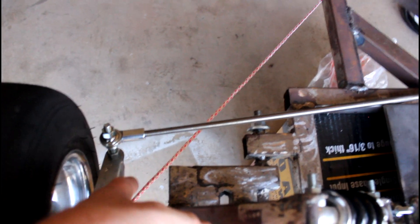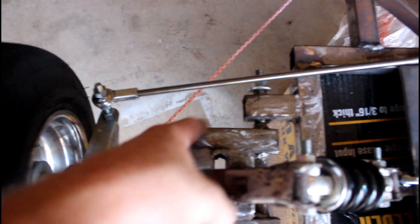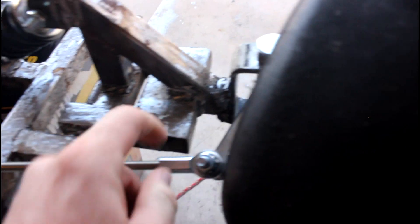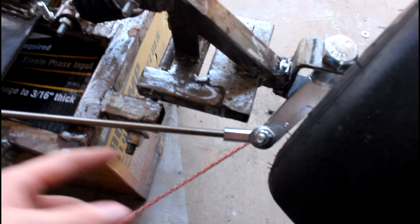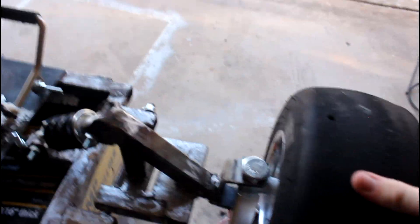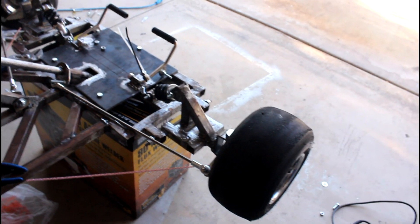What I'm going to have to do is build a bracket — most likely a triangular-shaped bracket — to connect this point over here, and I'll have to modify the suspension arm a little so it can steer farther in. I'm going to have to grind this part down so the spindle can actually turn farther, because right now the farthest it can turn is exactly along that line. I literally just figured this out five minutes ago and decided to film it.